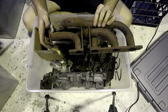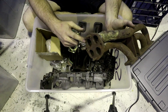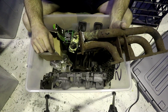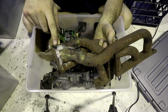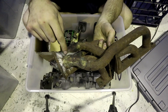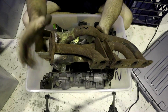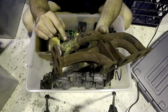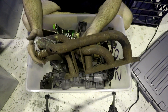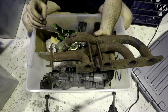These are the headers. One of the cool things about the S600 is it has a factory equal-length crazy exhaust manifold. The actual second half of the headers that bolt to this are super long — it's got all these crazy tubes and stuff under the car. It's got a really cool factory exhaust. This white stuff is flux, and you can see the repairs are like a gold colour — this has been repaired a long time ago because this is all brazed. I don't think anyone would be brazing this now because welders are so cheap and easy to get. It's a bit rusty, so that's why this has been brazed. I don't know if I'll be fixing this, but it's at least good enough that I can use it to make a copy. Mark that down as exhaust manifold.